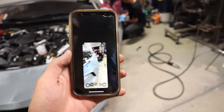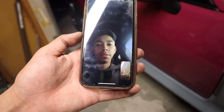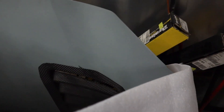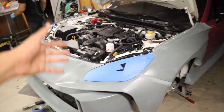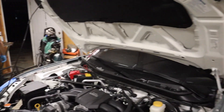We're gonna do the hood right now — here's how the car looks. This is the last thing we're doing today because it's getting super late: we're going to test fit the hood. This is the hood — it's all primered out, but when we wrap the car for SEMA I'm going to expose all of this carbon with the sick carbon vents. It's pretty much gonna finish up the whole front end for the night. Should be super simple — two 12mm bolts here, two over there, and it has a latch already. Just four bolts.